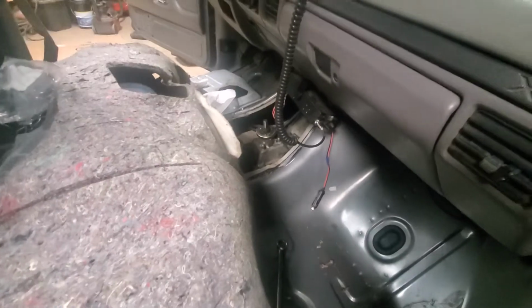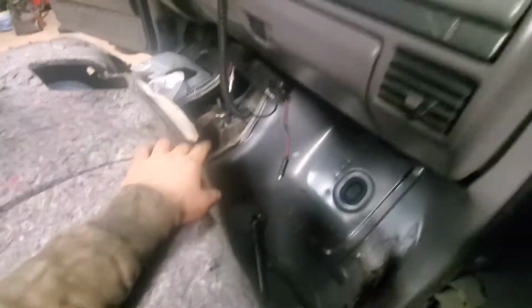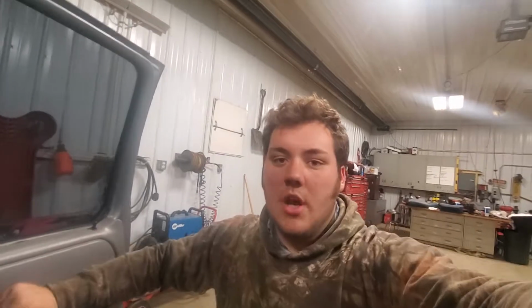So the easiest way to get to the transmission like that, to get that cover off, is to, pardon me, in the side door. So the easiest way to get that cover off without pulling the whole tranny is just to pull your flooring back. You've got 4 screws. There's one here, here, here, and there on both sides. Take that off. Take your shifter boot off. There's 4 screws in that. 4 screws over there in your transfer case if you have 4-wheel drive. This is not 4-wheel drive yet, okay? Yet. So keep my fingers crossed that it will be 4-wheel drive one day.